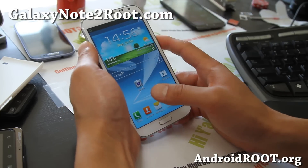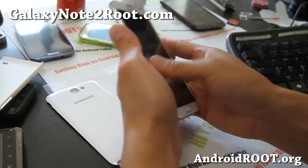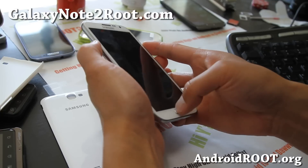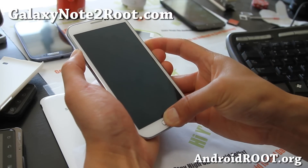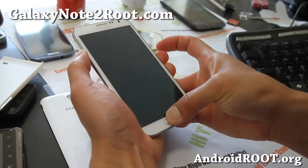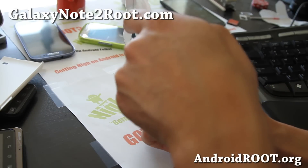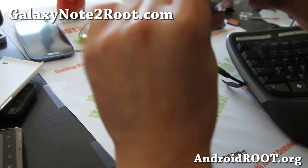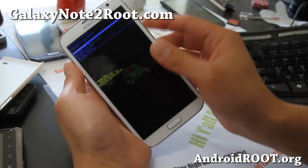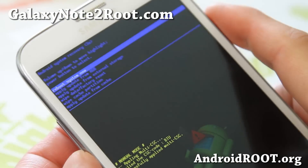If you don't get to that point and your phone is still in a boot loop, go ahead and plug it in, then hold volume up, center home, and the power button — let go of the power button but keep holding volume up and center. This will enter you into the stock recovery where you can do a reset. Make sure you put the back cover on carefully. Here you'll see the menu to do a factory reset — 'Wipe data / factory reset.'